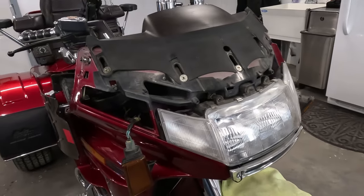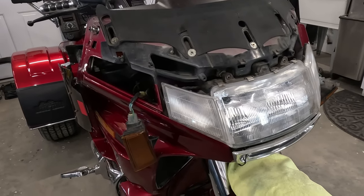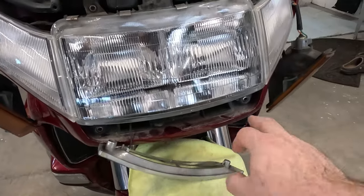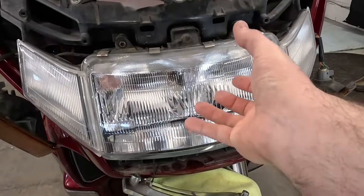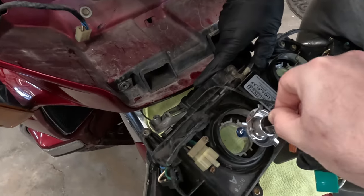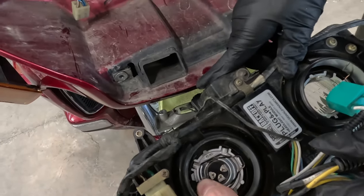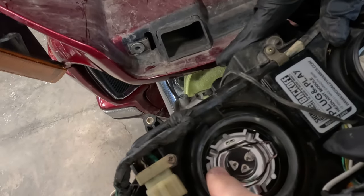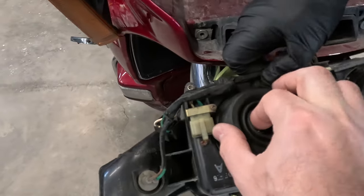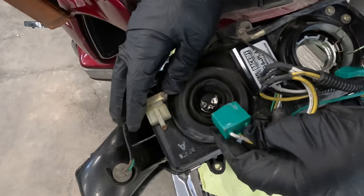We had this all apart, and the bright lights were not working. We discovered that the bulbs were burned out, so we picked up some new bulbs and now we're taking the headlight assembly out. There are two bolts here, one here, one here, and then two screws to pull this chrome piece off, and another two bolts right underneath — 10 millimeter, all four of them. Then this comes out; there's one plug behind there. We insert the new bulbs — be careful not to touch the bulbs. The spring comes down and clips in right underneath, like so. Then put the rubber boot back over the bulbs.